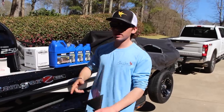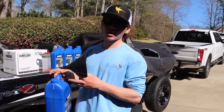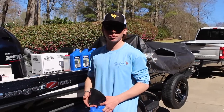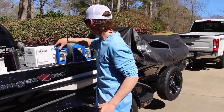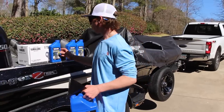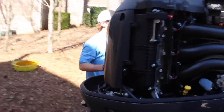On the engine it says from Yamaha that you want 7.1 quarts, but we're going to use 6.7 — that's what all of the Yamaha techs we know recommend because this engine can make some oil from time to time. We have four quarts and then three more quarts — we're going to go through both of these and about half of the next one, then we'll check the dipstick. Follow me around here and we're going to pour this oil into the reservoir.